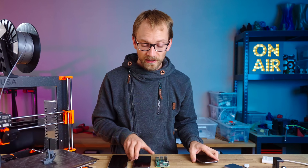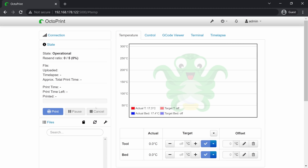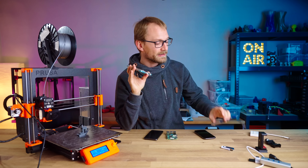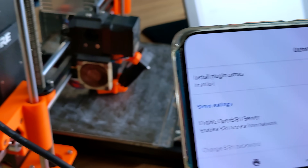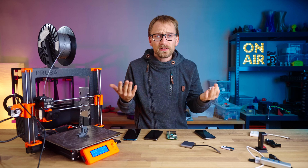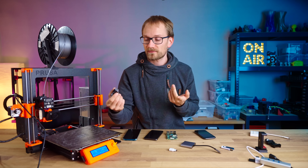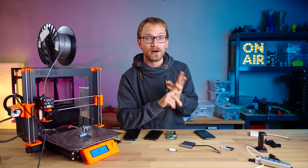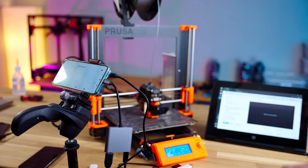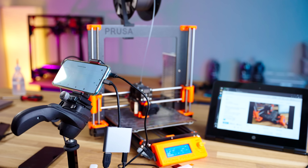If you look at the experience you're getting with the 4.5-year-old LG G6 and the Poco F2 Pro from last year, it's pretty much flawless in both of these. The only thing I could find is that with the Poco, you can't use simple passive adapters — you have to use a dongle like this with power plugged in. The G6 works without the power plugged in, the Poco doesn't, but that might be down to the broken charge circuit. But once you figure that out, it's literally just like any other OctoPrint install. The interface is snappy, it's reliable, it printed just fine. Plugins work, and with stuff like Octolapse having access to the phone's main camera, you can actually get some really crispy timelapses. It's a really good experience — I tried if there would be hiccups when you do stuff in the UI or upload files while the print is going, but it's just really smooth everywhere.